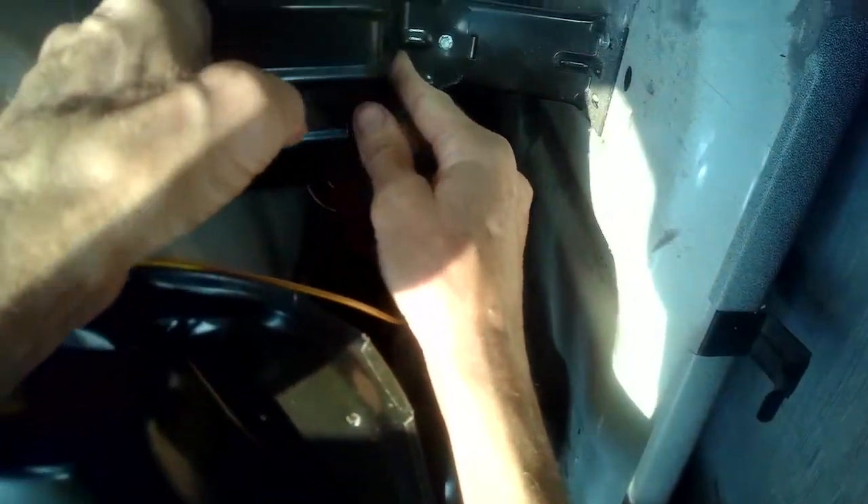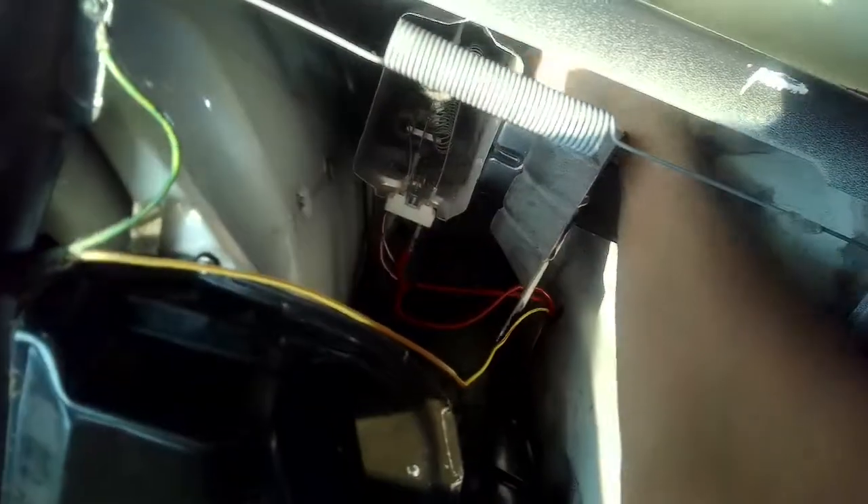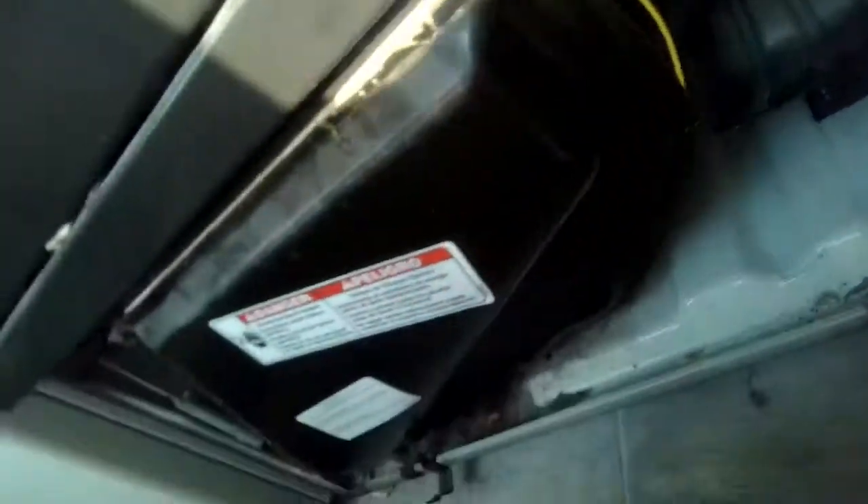I bend this back so I can now see how the heater is doing when I turn it back on. While I'm in here, I'm going to remove some of the lint that's built up — this helps to avoid a fire danger. So make sure it's unplugged and reach in to get rid of as much lint as you can.